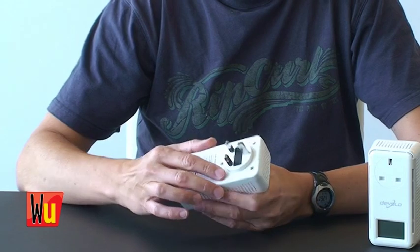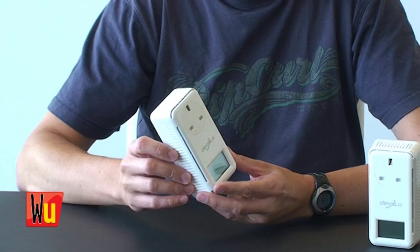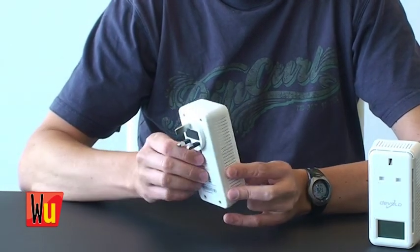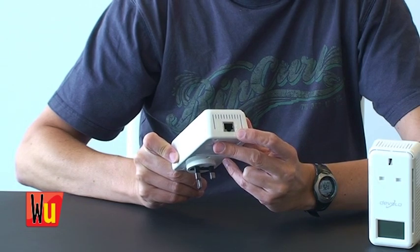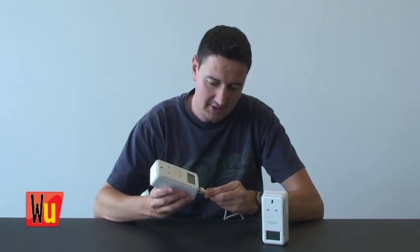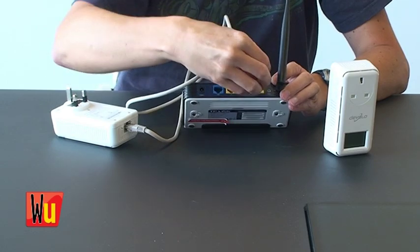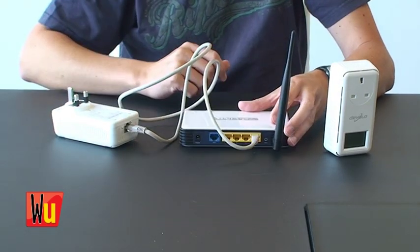So this is a home plug. Basically what you've got is a plug that goes into a standard wall socket, and some of them are just a plastic box with a plug on the wall socket and an ethernet adapter on the underneath for plugging your network cable into. To set up a network, all you need to do is have two of these. Plug an ethernet cable into the ethernet socket on the bottom of both of them, plug them into the wall, then connect one to your router to bring your internet connection into the house and the other into a PC, and they should just work.